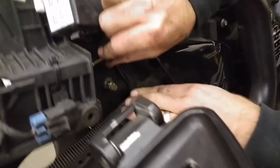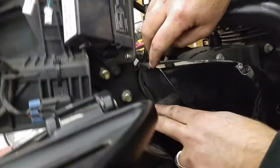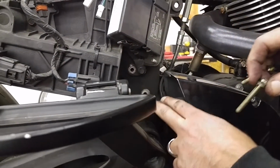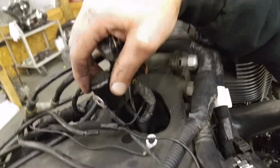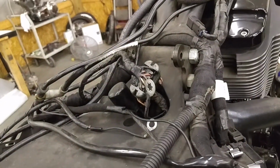And these 2 bolts are located right above the belt assembly. The 2 gold bolts will be right here. You'll see in this location. So once we remove those 4 bolts, that will allow us to drop out the cruise control module. Another little tip that might ease in some of this is there's a hole up here on the top side, and I've pulled some of this wiring just up and out of the way a little bit. This cruise control module is going to have to be rotated, and then we're going to reinstall our bracket.